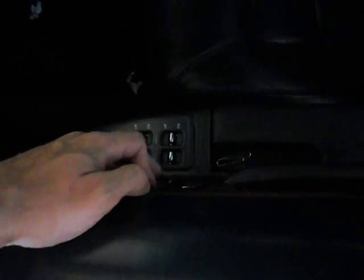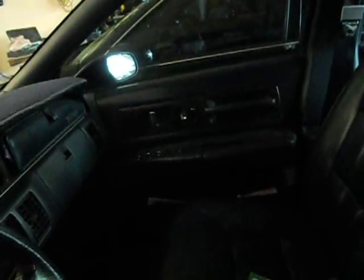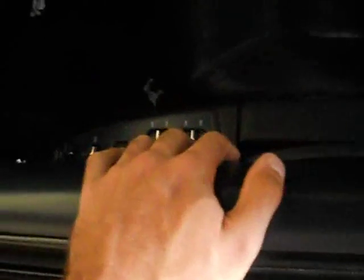Playing around with the box — it works again. Except the driver's door will never unlock, because it's a different circuit than the rest of them. The passenger side — zoom in — watch the lock: it goes down, up, down, up. That door works. This door does not. It's because the circuit's screwed up — it's a different wire that runs from the box to the driver's door.